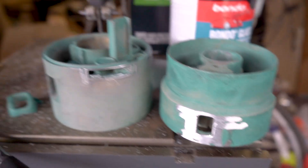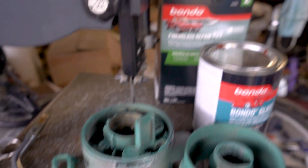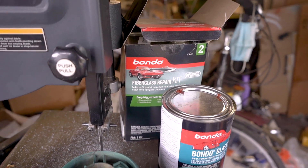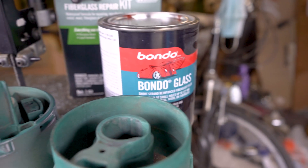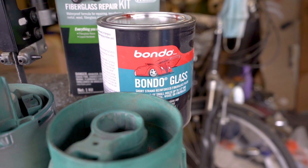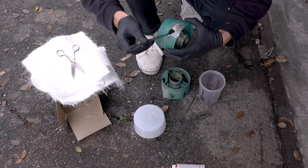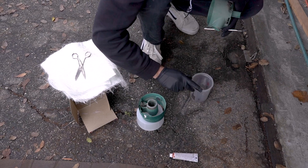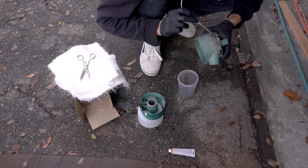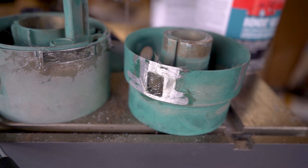Alright, pieces are ground down and this is what I'm really using to fill in these holes. First I'm going to put down this fiberglass repair kit, just because some of these holes actually go pretty deep and I don't want the bondo glass — the short-hair fiberglass fibers — to fall through the hole. So I want to give them a crude backing before I put that down, and then do a skim coat on top. That is looking good — it's just a thin fiberglass backing which is going to prevent the bondo from pushing in when you cover it.